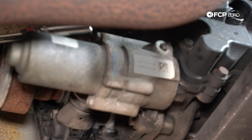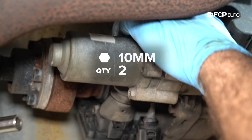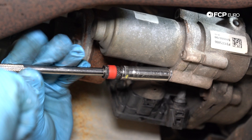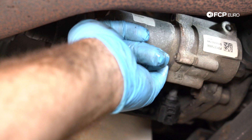There are going to be two 10mm bolts that hold this pump on — we're going to remove those. We'll start on the top. I just cracked it loose and I'm just spinning it out with my hand. Just a mental note: on these cars you do see these pumps fail from time to time, so if you're trying to do a little bit more preventative maintenance, you're taking this pump out anyway, so it's not a bad idea to replace it at this time. This one is working fine — this is my personal car and I'm going to leave it in.